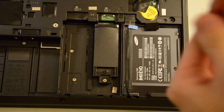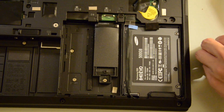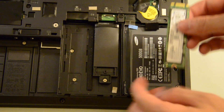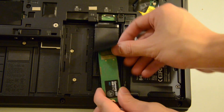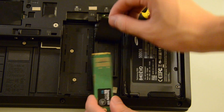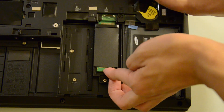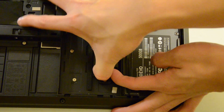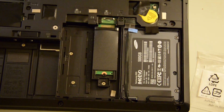Now we want to use the single screw provided to attach the M.2 SSD to the tray and to the computer. To insert it, insert it facing up with the label facing up into the M.2 slot. Push it in until it clicks — it's all aligned for you, quite simply. Then place in your single black screw that you got with the tray.